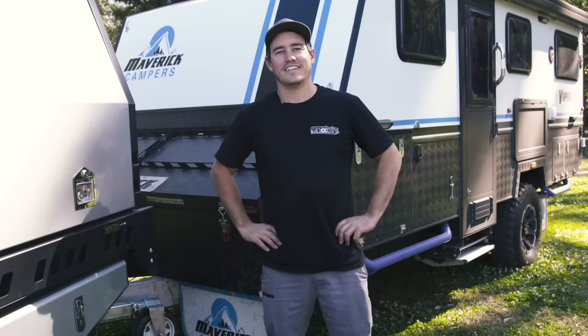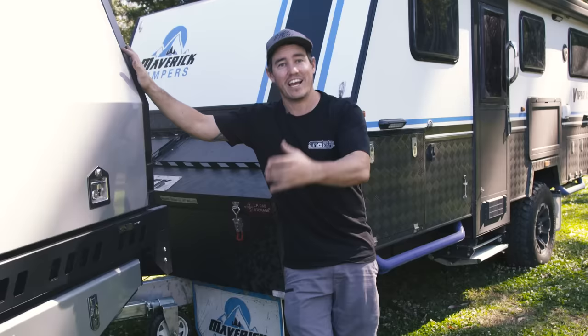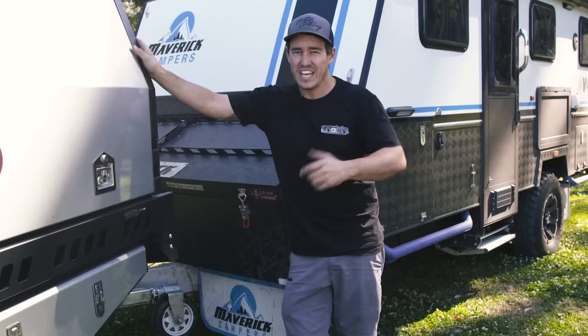The single most important factor when towing is weight — from the weight of your trailer to your tow vehicle, your tow ball weight, your GVM, your axle loads, your tyres, your wheels — all of that and so much more is very important. You need to set up your vehicle correctly to be able to take the weight as your very first step.